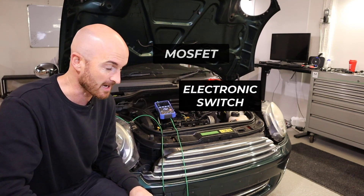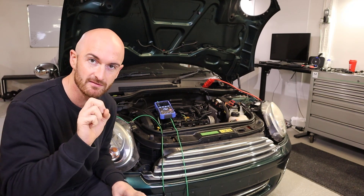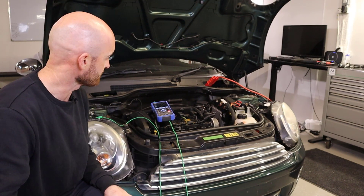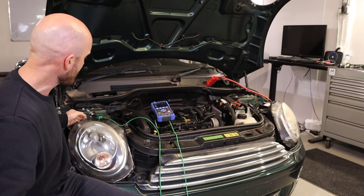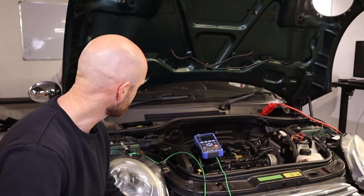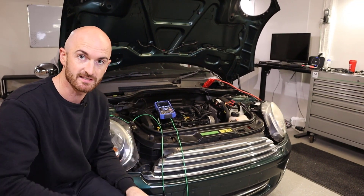It's a kind of transistor. However, just to make sure that it's safe, it has to ping a very small signal when you turn the ignition on just to make sure that line's okay. And you can actually hear it — if you listen to the bulb when you turn the ignition on, you can hear it's almost ticking like a watch. Listen to this.